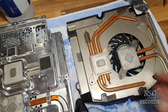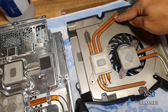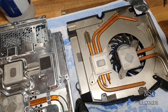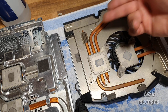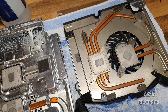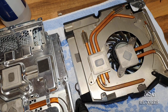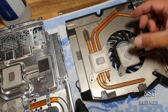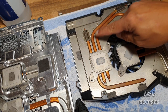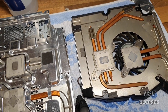This was very important to show you guys, because it's not only about the CPU, heat spreaders, or thermal paste — that has nothing to do with the heat pipes. The heat pipes are the most important thing ever. If the liquid is just not there anymore, these are not heat pipes — they're just copper sticks that don't work like they should. So don't forget: if you can get a good cooler on eBay and you're lucky that its heat pipes still have liquid, you're going to have much better cooling.